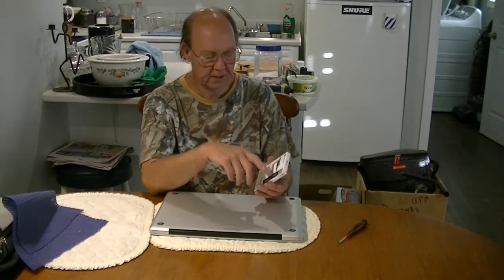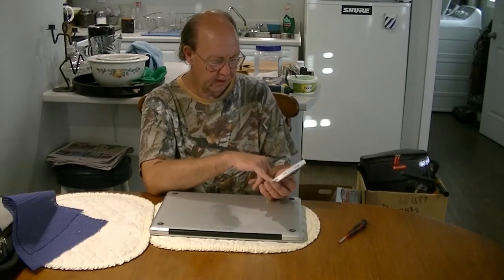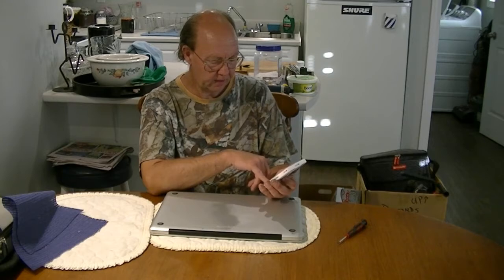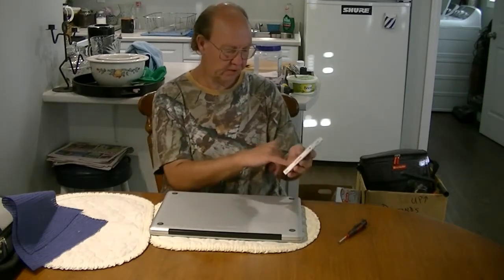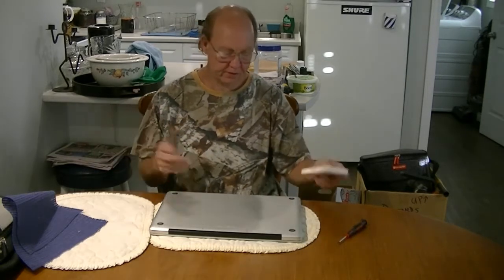In case you're wondering, it's DDR3 1066MHz — two times 4GB sticks. Some MacBook Pros may support more than 8GB so check your specs first. This RAM is listed for MacBook and MacBook Pro mid-2010, early 2011, late 2011, iMac mid-2010 and mid-2011 — but it's also compatible with this mid-2009 model. Apple is kind of like car dealers: it's released for the following year even though they called it 2009.